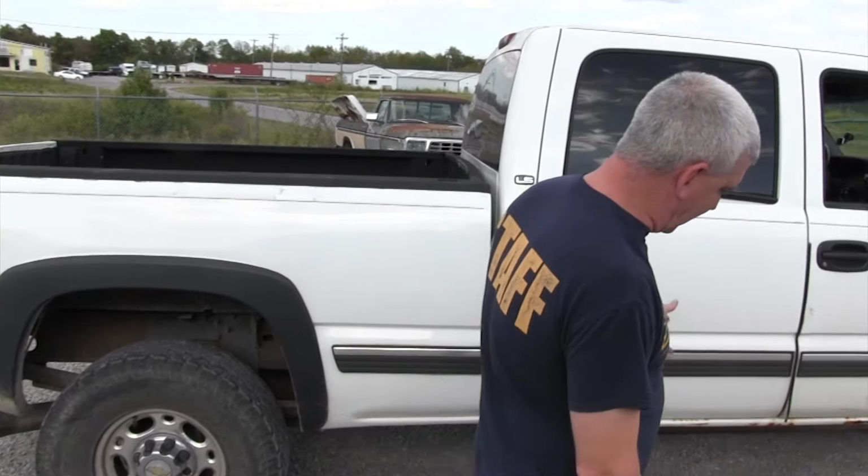Next component in the driveline is the transfer case. Everybody knows transfer cases on Duramax trucks, on the Chevrolet trucks, have the pump rub issue. If you buy one of these trucks, look for a leaking transfer case. Look for a transfer case that has been taken off the truck, with JB Weld on it or something like that. There are a lot of different fixes out there for those. A lot of good companies, Merchant Automotive is one of the first that comes to mind, make a pump rub fix for these trucks, with full instructions. We carry that kit on the website.